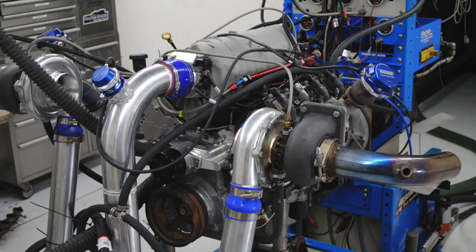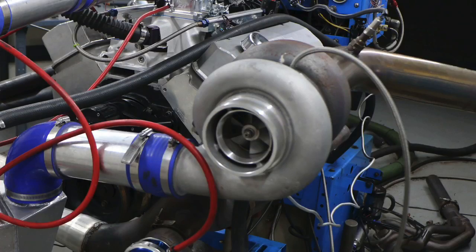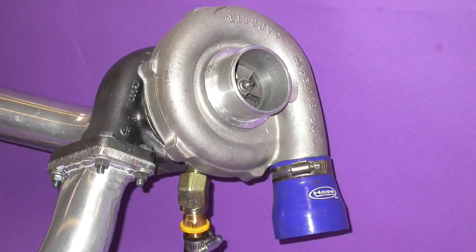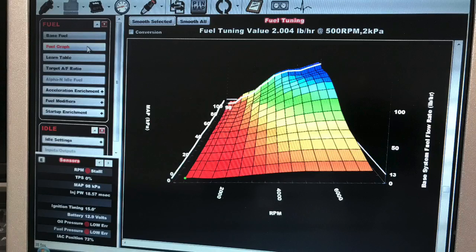What did we learn from running three different combinations that made over 900 horsepower? Looking at the small picture: we can exceed 900 horsepower with a modular Ford, an LS motor, or a big block Chevy. But here's the big picture — you can apply this to any combination. Take your motor, whether it's a 2JZ, a small block Chevy, a 4.3 liter V6, an Atlas, or a rotary. Make a few minor modifications to improve the NA power, then add boost and good things are going to happen. You need octane, intercooling, the right tune, good head studs, and proper ring gap. Make sure to like, share, subscribe, and ring the bell. Turbos are awesome — more testing coming up.